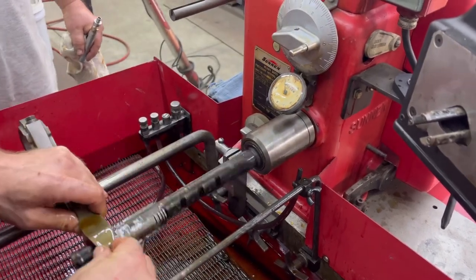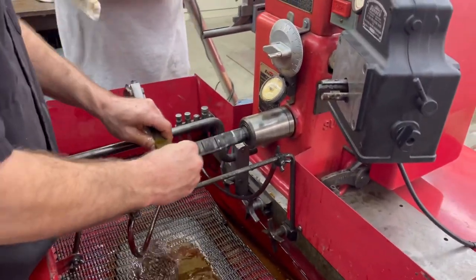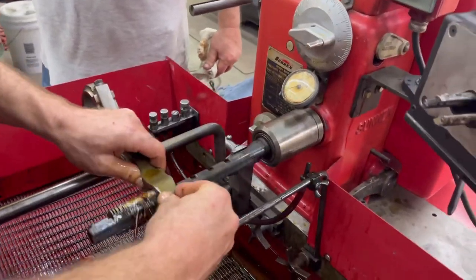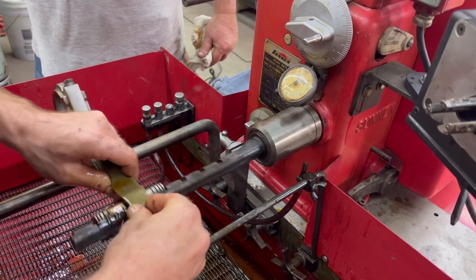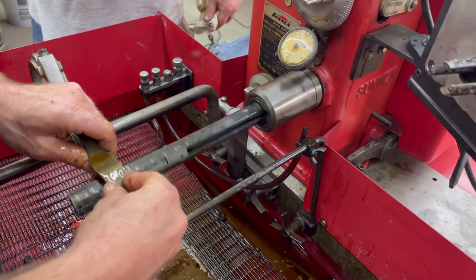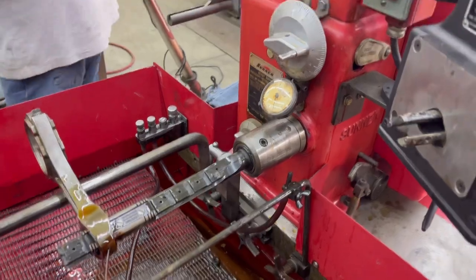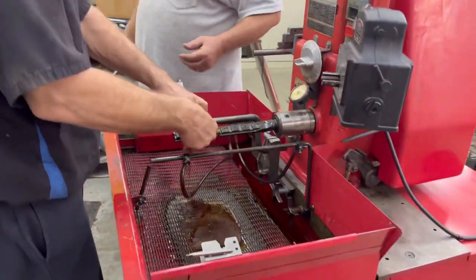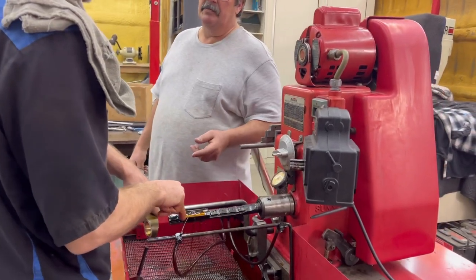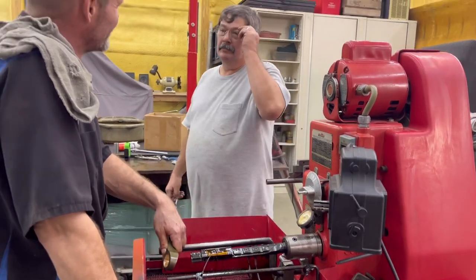Oh, hey, come on. You got a total of seven, right? Yeah, roughly. What I saw. Yeah. We'll measure it, see what you did. Stroke past a little more, or what do you think? It's looking pretty good. You feeling any difference in the torque front to rear? Stop now. You get to zero, you're done. Let's measure, front to rear. It felt like the stones on this end were lighter. Which means you got to taper. It's smaller at that end than this end, so stay on this side a little.